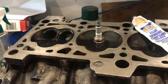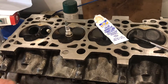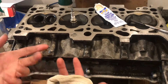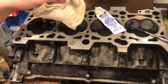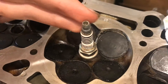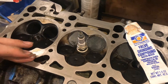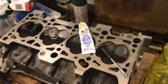This passes the water test, so we can go ahead and move on to the next cylinder. We can test this again whenever we put the springs on — we'll have all four spark plugs in and we can test all of them. We could even take some compressed air and spray just a little bit up these just to see if it bubbles at all around the valves. But I'm going to go ahead and just take an old sock and soak up the water. We found that doing the water test method has always worked well — whenever we put this all back together, it has good compression and we've just had good luck with this test. I hope you guys found this video useful — if you did, don't forget to like and subscribe and we'll see you next time. Thank you.